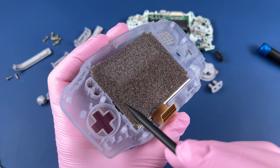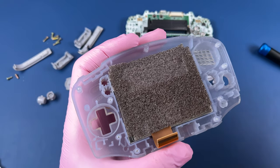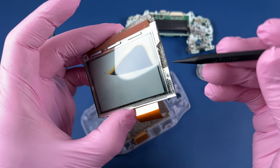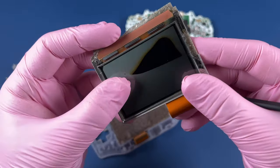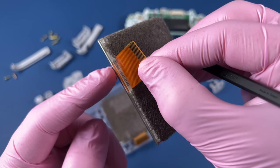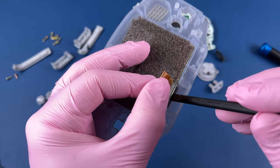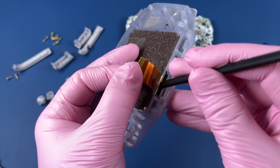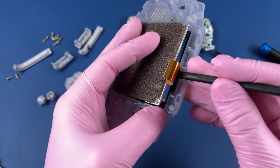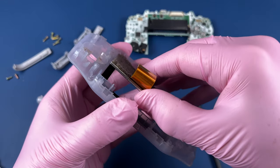Here is the screen. What I did is I put the pry tool inside of there, which I have now learned is actually probably the worst place you can put that pry tool. Looking at this one, that's basically the only part of the screen that doesn't have a metal protecting edge around it — it was just asking to get broken by prying up there. So instead I'm going to go underneath this ribbon cable right here, where there's good metal bracing that runs all around the edge. I'm still going to be very careful, lifting very slowly and listening to the sound of that tape come up. I'm not pulling on this cable, I'm just holding it out of the way — actually holding the system still with my pinky and ring finger. I don't want to pull that cable out.